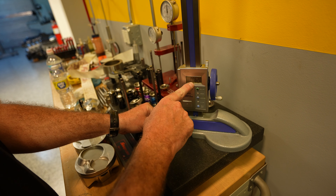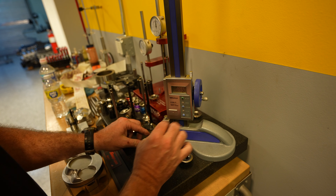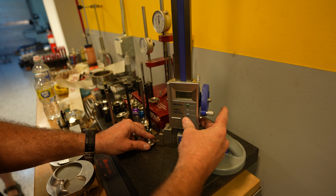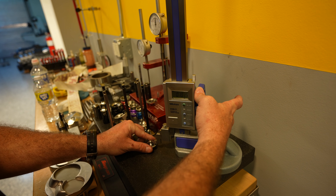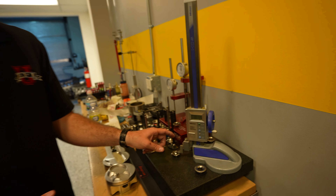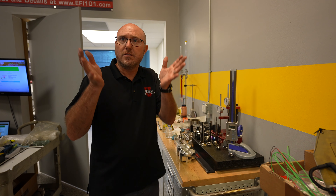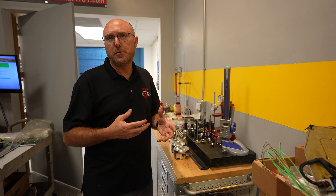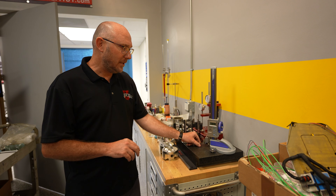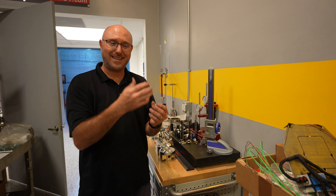If I put this ball in the other retainer and it sits lower or higher, that's going to change the point where my locks fit and it's going to change my installed height. I can see that my 9/16ths ball sits at 62. So if I grab my other retainer and do the same thing, come over here, zero off the top of my retainer, come over here to my ball — it's 73, about 10 thousandths of an inch different. So we had about 5 or 6 thousandths difference on the thickness of the step and about 10 thousandths difference on the cone, but we're going to be in the ballpark. It won't take a lot of shim to get close to the same installed height, but that's a really important check to be making when you get new retainers. Put your ball in there and make sure all your retainers are at the same gauge height.